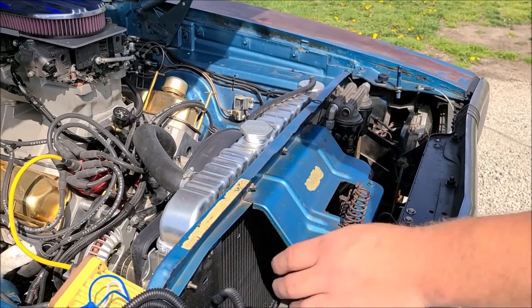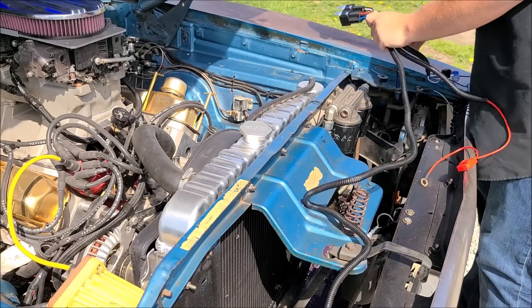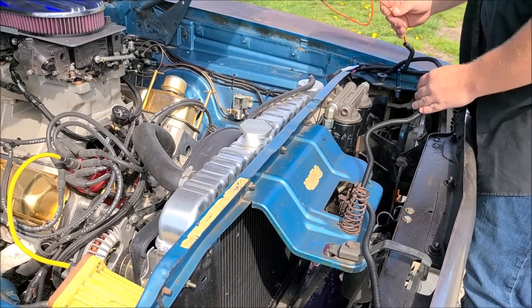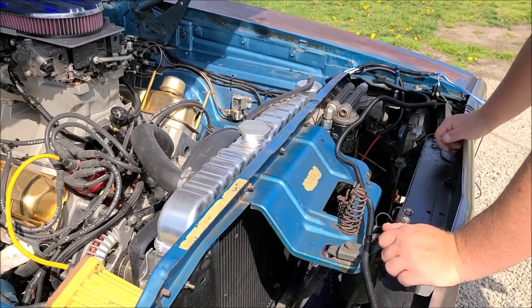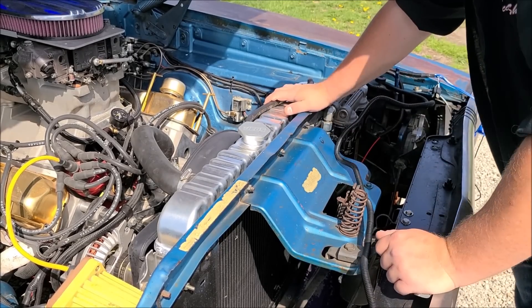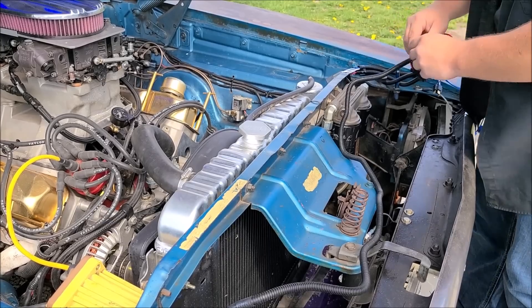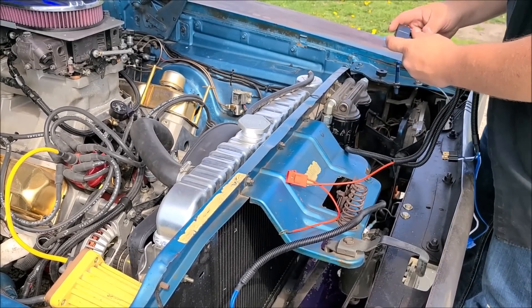Alrighty, so we know the short side of the harness is over here. That's going to sit over here, and this will need to get routed to the other side of the car. Our battery's in the trunk, so there's no way that power wire is gonna reach the firewall. We've actually got a main power lug up on the firewall, so we're gonna extend this wire and run it all the way to the firewall. It's got a little fuse in there. We'll time-lapse some of this and get it all hooked up and see how it works.